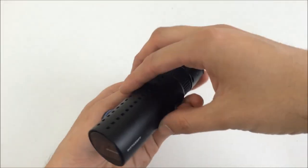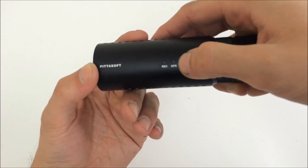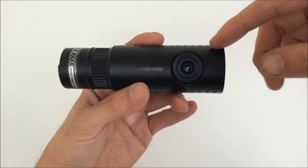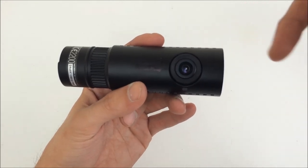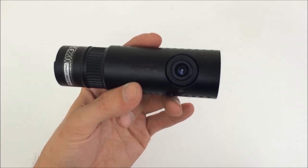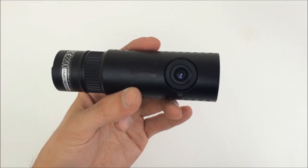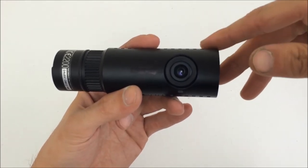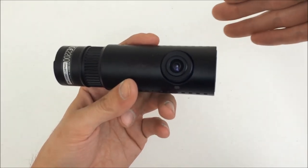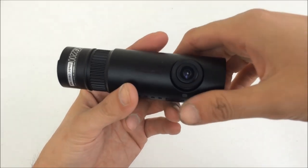The GPS is obviously another nice feature that usually only cameras that are at least $100 have. I said in the previous video that I thought the GPS was necessary for the parking mode. I'm not even totally sure still — I thought the GPS was necessary for the camera to realize it's suddenly moving again, but that could just be the G sensor also, because I'm pretty sure when I've accidentally bumped the camera while in parking mode it switched to normal recording.